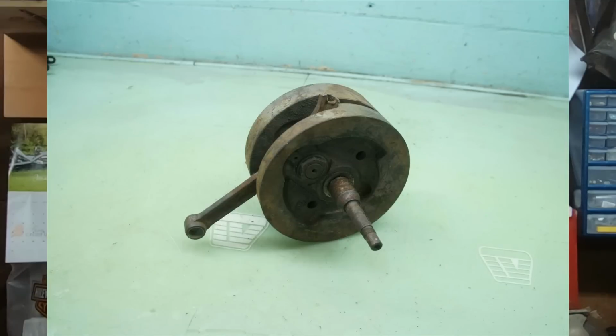And also an enlarged sprocket shaft. Now the crank pin and the sprocket shaft are now made out of 4620 steel, which is much stronger and also way more machinable. So you're going to get a higher quality of machining in these years of Panheads, granted with how old they are. They still got the period correct crank for that year.